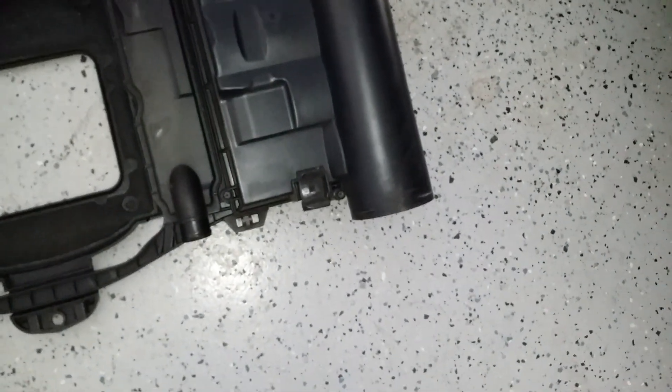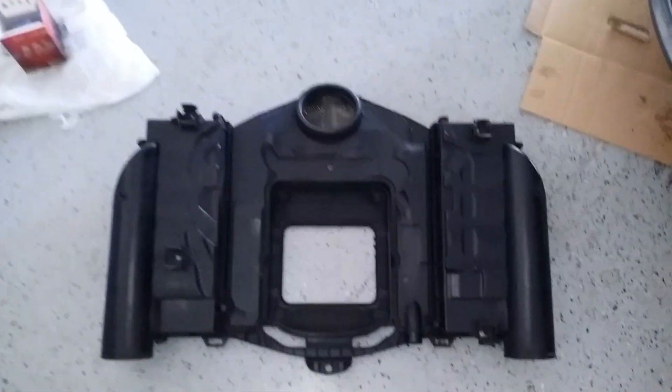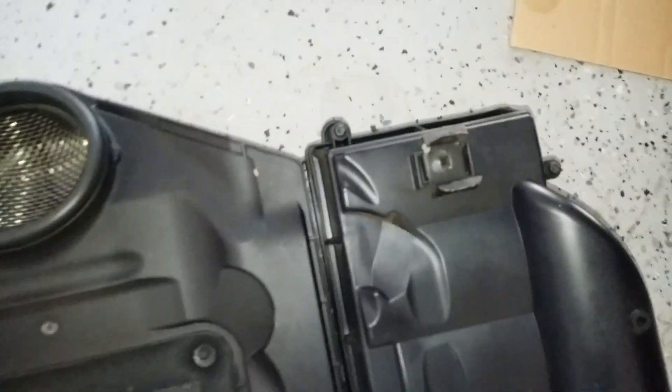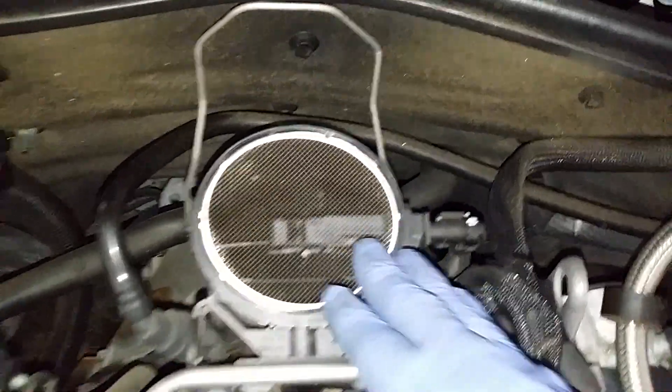You really can't get these wrong. Both ducts have to stick out on the outside. Now just tighten back down your T25s. Once you tighten down your T25s, those two brackets there will sit on these bumpers — one here and one there. Make sure you get that housing seated on there properly.